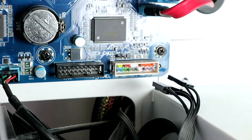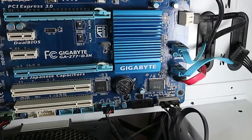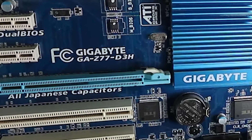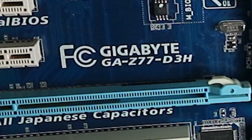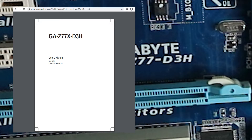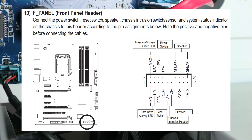Start with the bottom row so you can see the labels, and then continue with the top row. So what I do is I find out the name of the motherboard — in this case it's the Gigabyte GA-Z77-D3H. I use that term, just GA-Z77-D3H combined with the word 'manual', and Google that. I pick the first result on the official Gigabyte website, and that leads me to a PDF file where on one of the first 10 pages I will see a map of this mainboard. By searching specifically for 'front panel header' I can find an even more specific diagram showing where to connect what.